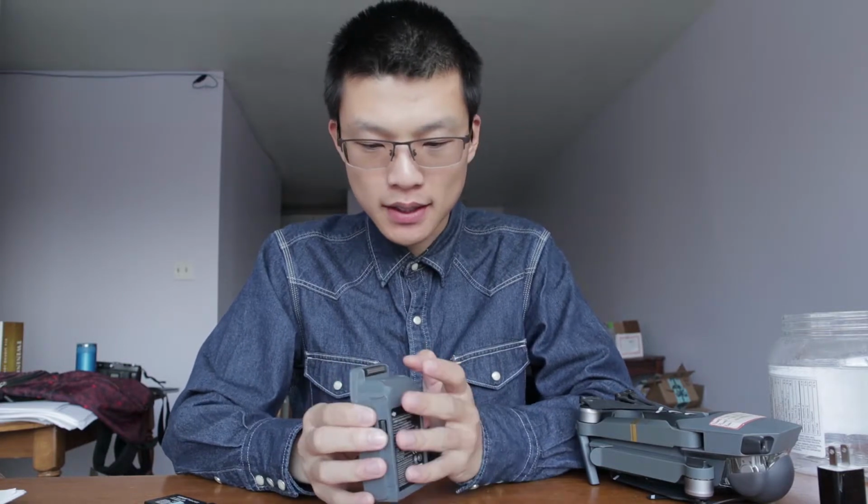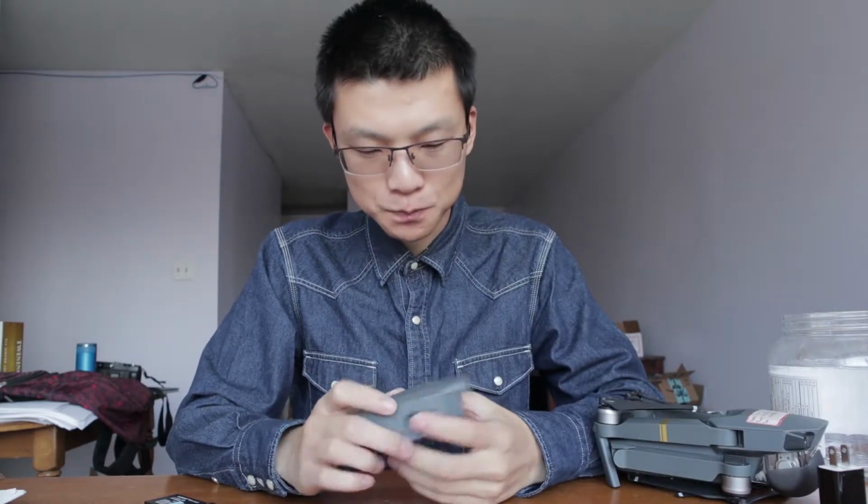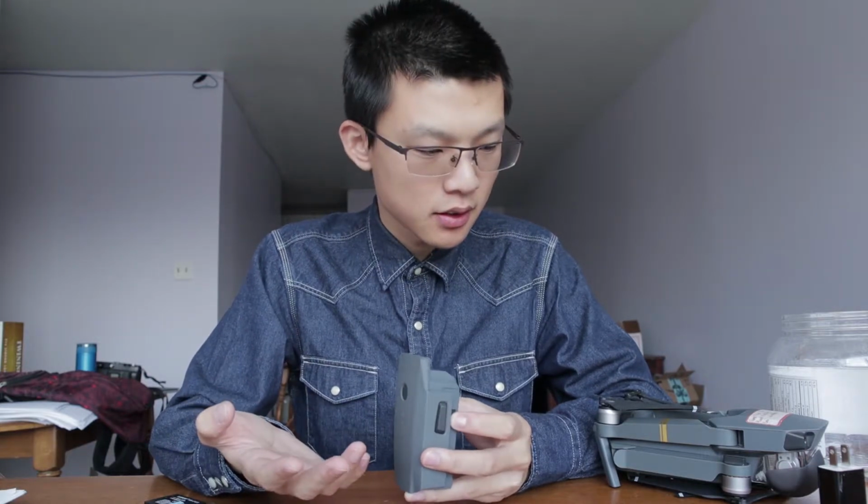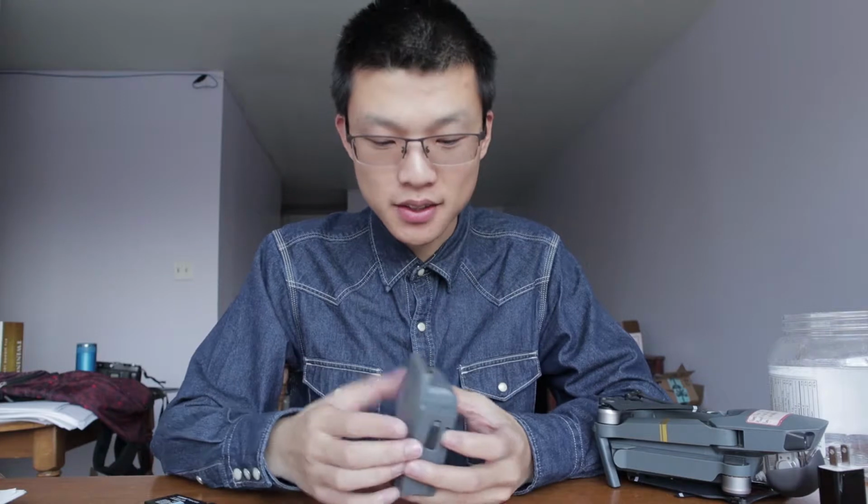you will feel the battery is actually a little bit warm. I think the same heating elements or the same resistors, what they do is when the temperature of the battery goes down too low, like today it's flying outside and because of the wind blowing and the cold temperature outside, the battery loses its temperature very, very fast, and under a certain threshold, like 21 degrees Celsius in this case, it starts to warm itself up, because you don't want your drone's battery to die all of a sudden, which leads to an air crash, right?